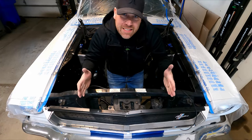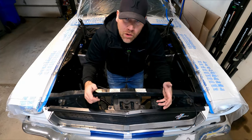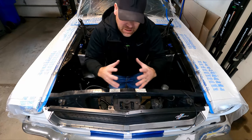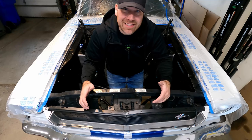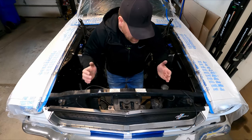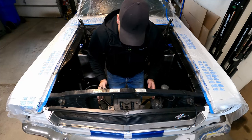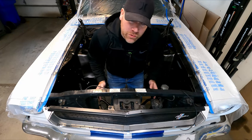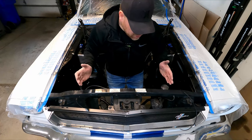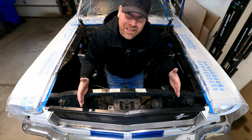What normally fits in the '65-'66 Mustang is a 16-inch radiator, and really it's sufficient for most of what people are gonna do. I'm doing something a little different with my motor — I need a bit more cooling capacity. The problem with these cars is the way the core support is cut out — it's not set up for a 24-inch radiator. I think the '67 opened it up to a 22-inch or so, giving more options. But with this one, we're gonna have to cut the core support to make it fit.